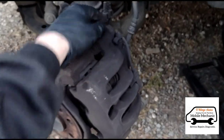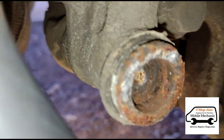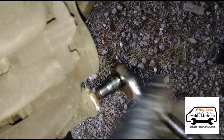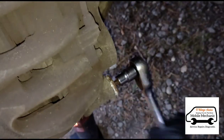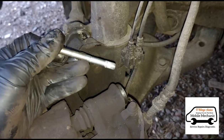I've just turned the wheel to the right so we can see — we have some rubber caps on the back here and I'll get these pulled off. Now I've got the rubber cap off, you can see it wasn't sealing too well because the nut doesn't look in very good shape. We've just got a six millimeter Allen hex key on there and it is turning thankfully. Got that bolt out and now the top one out too — the top one's in a lot better condition because it's away from the floor a little bit more.